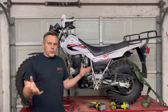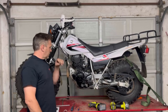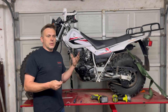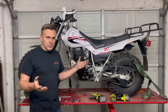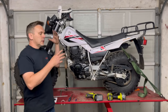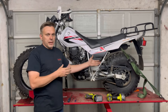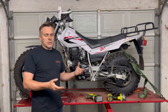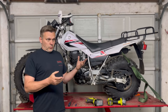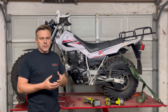For the reasons why we're doing this — this engine is just an air pump like all combustion engines, and it's all about more in, more out. One modification by itself is not going to be very noticeable. If you just put on a pipe and don't jet properly, everything has to match — it's all about tuning everything together. This cam sprocket by itself with no other modifications is not really noticeable; it is designed as a tool for engine tuners.